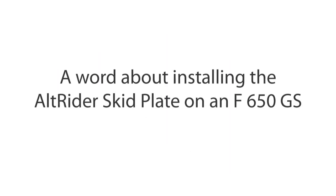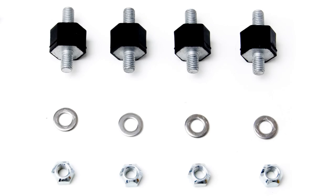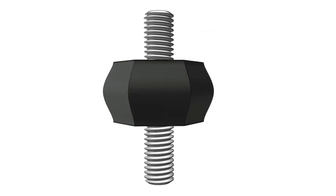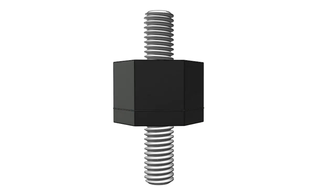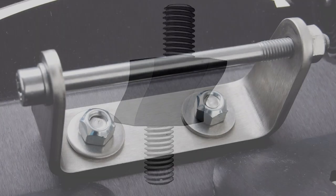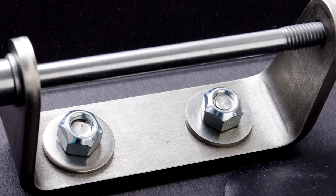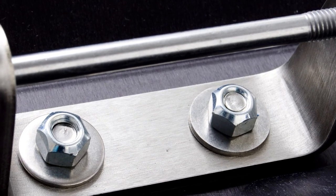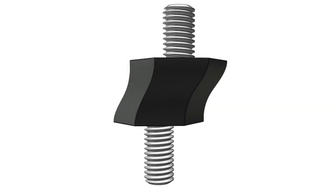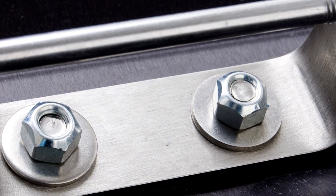If you are installing the Alt-Rider skid plate on an F650GS twin, you'll need to first install these OEM vibration isolation mounts. These mounts are constructed of high-density rubber between two metal plates with threaded bosses on either end. They're meant to absorb vertical impact, damping the forces applied to the skid plate when hit. Excessive load applied laterally or perpendicular to the threaded bosses is called shear load and can destroy these mounts very quickly. That's why our front mount bracket is made with short arms of four and three-quarter millimeter thick stainless steel — in a big impact, this bracket holds its shape well and acts as a pivot, allowing load to be transferred more in compression than in shear, letting the vibration isolation mounts do their job without stressing them so much that they tear.